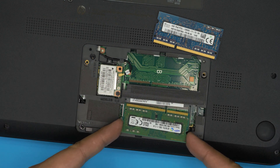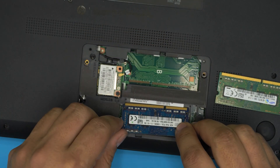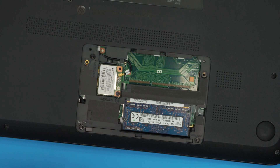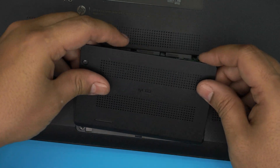Pull out the old one and put in the new one — just grab it and slide it right into the board. That's how you upgrade the RAM. I'll try to find a good link for 8GB DDR3 RAM in case you need it.